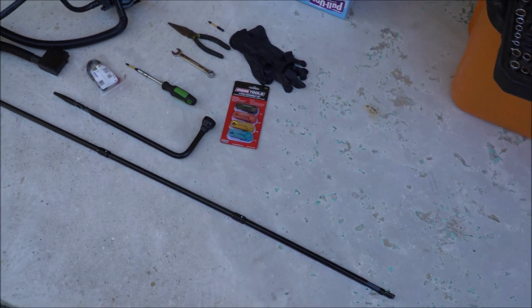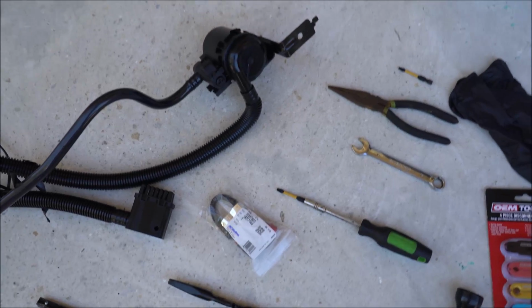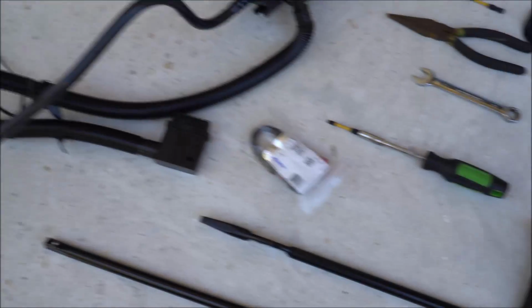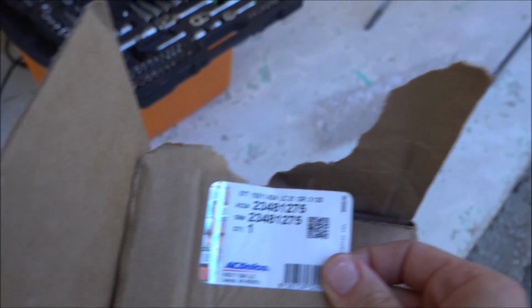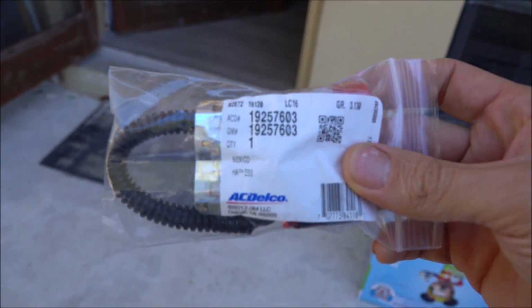This is everything you need to get the gas fill solenoid taken out and replaced. So you got the new gas fill solenoid, and that is part number 234-81275, GM part number 234-81275, and I got that from AC Delco. I'll put the link below. You also need the cylinder wire, which is 192-57603, and that is also AC Delco.